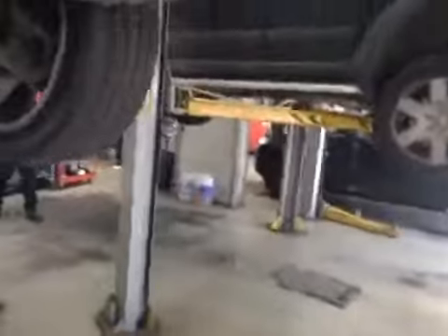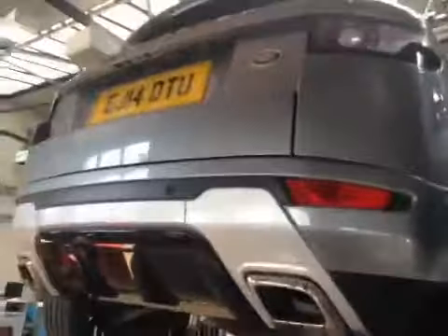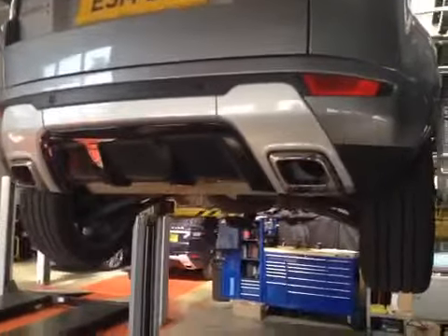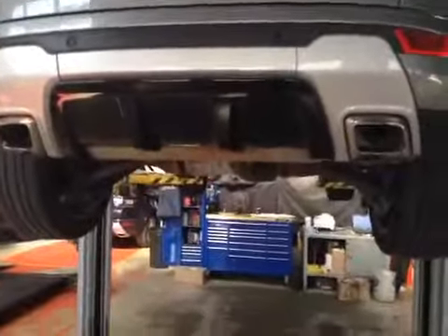Reference your concern of your driver's side rear light unit — flash flickering. Your lamp unit is full of water and condensation. This will be the cause of the problem with your brake light, and I've also noticed that your offside rear side light doesn't work. You will require a replacement new lamp unit.